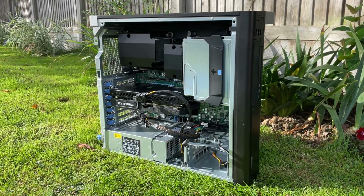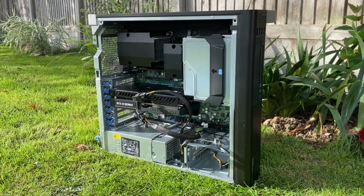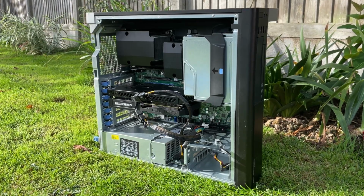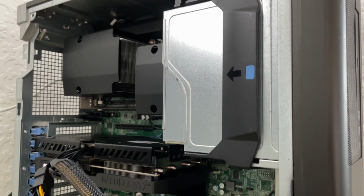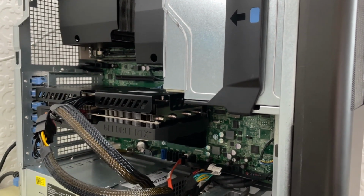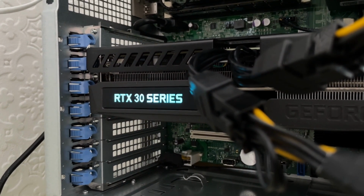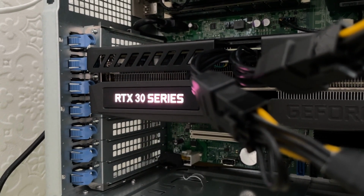As we look at some game results, I want to remind you that a more upper entry level or lower end mid-range card would be best suited as a pairing for these aging Xeons, but I wanted to get the most out of them today, and that meant using a card that would allow them to reach their maximum potential. Sometimes the older architecture lets them down though, and on other occasions not all the threads are utilised. There is still fun to be had regardless, and when you consider that E5 2630s can be picked up for as little as a £5 here in the UK individually, I think the following results are all the more impressive.